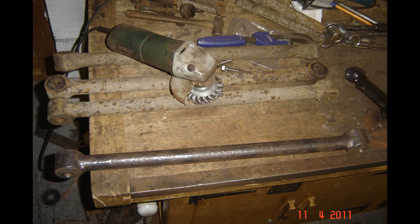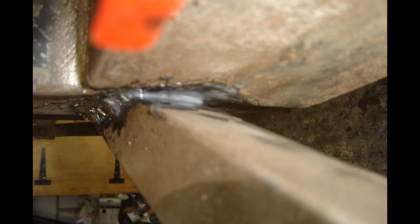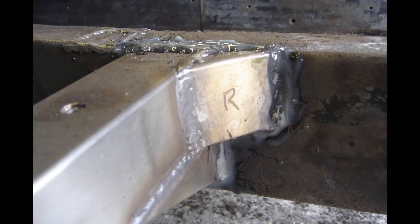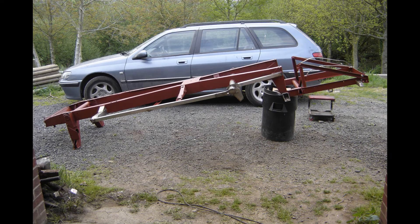With all those points in place, I cleaned up the four links as well, ready for paint. Of course, between the stainless steel and the mild steel you get accelerated electrolytic corrosion, so I used a lot of Araldite — which is an insulator — to seal all of those welded joints. Then I'm into spraying red oxide paint onto the crustier bits, all cleaned up, and all of the mild steel is red oxide painted.